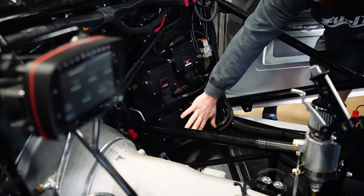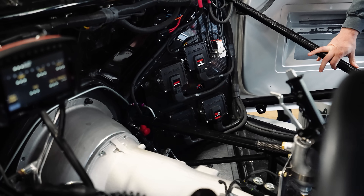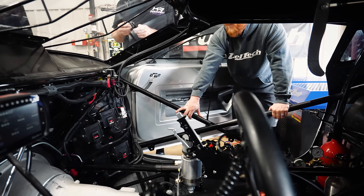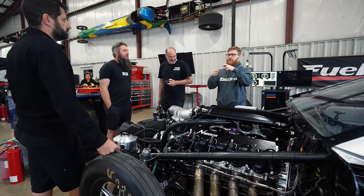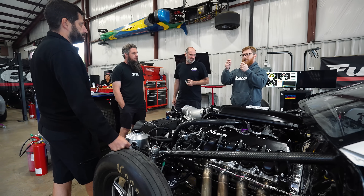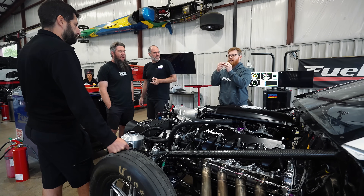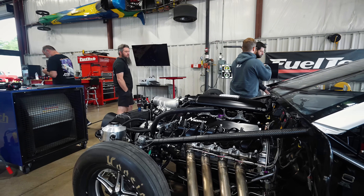Some wiring in here for the peak and holds before we do a run. Right now the peak and holds control the fuel injector relays and I don't like that, because if there's any kind of interference or something like that, I can shove one bank of injectors off. We need to peel those boots back and then just take that brown wire, pull it out of the connector and connect it right there because the rest of the harness is sealed. We'll have to do it really close to the connector. Do we have the little brass ones that we can slide with these little brown pins out?